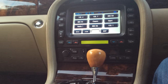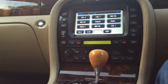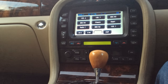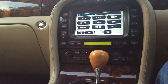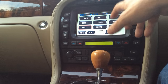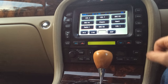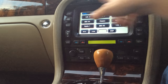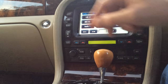I just wanted to give you a demo of a little upgrade I've made to my Jaguar touchscreen head unit, which is to include Android functionality. There's an Android system running on an Odroid single board computer installed in the glove compartment. The LCD panel has been completely replaced with a new panel, a new video controller, and the video controller is running some custom firmware which can take the RGB signal from the DVD nav in the boot, but also can take HDMI input from the Odroid.